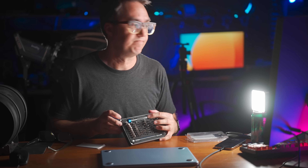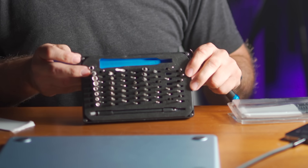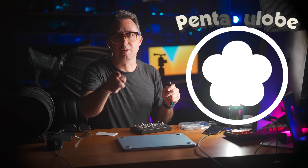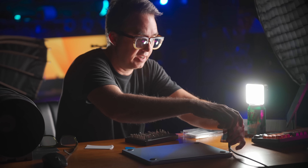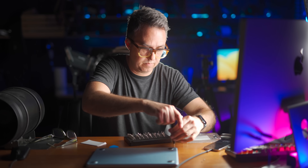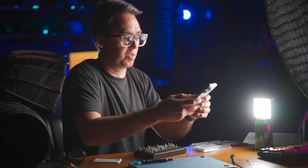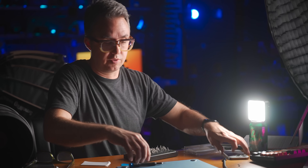To get this computer apart, you need a somewhat boutique set of tools. I'm using the iFixit Pro-Tech Toolkit, because Apple uses really funny little screws. These four screws on the bottom of the case are called pentalobe screws — it's like a five-headed cloverleaf. It's just four screws, but pay attention to the ones you take off because the front screws are different than the screws next to the hinge. They won't be all that tight. The screws with less threading are the ones near the hinge; the screws with more threading are the ones towards the front of the computer.